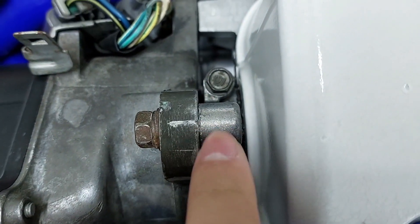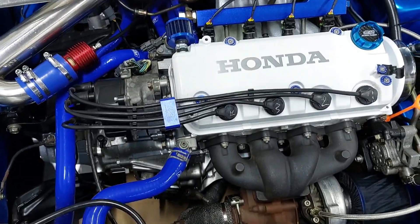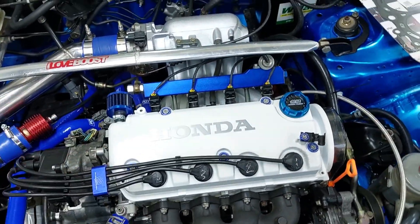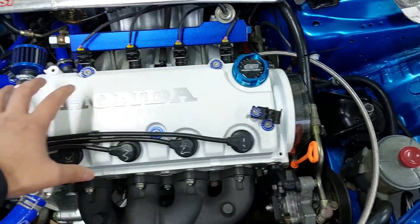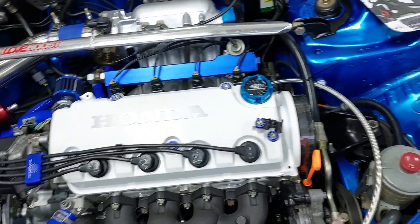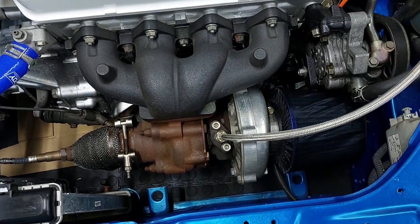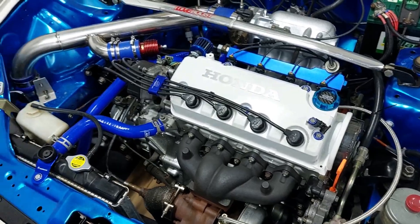Make a mark — as you guys can see I already made a mark there, so that mark and this mark here — if they line up the ignition is set. But other than that it's not really that difficult. Once you have all those things loose you can actually get to the bolts and take them out without disassembling anything inside the head. If you have a double overhead cam B-series you have to sadly take out the cams as well, which makes it more difficult, but with single cams you can get to the bolts without taking out anything. So once the valve cover is off you can take the bolts out and if everything is loose around it you can take the head off. If you overheated your car you may need to check the surfaces on both the block and the head because it might warp. However I know this engine did not overheat — it basically stretched the head studs because we were running a bit too aggressive ignition timing combined with boost and a slightly higher compression setup, and that's where we started pushing compression into the coolant. I'm going to put it on a time-lapse and show you once we have the head off.